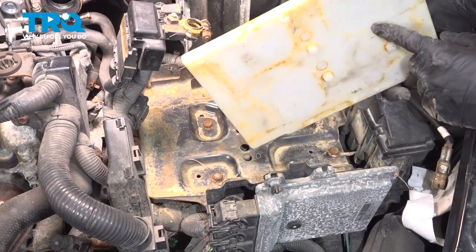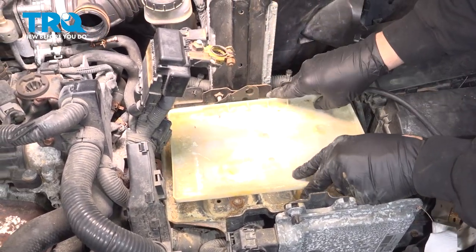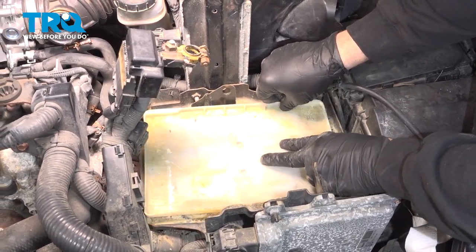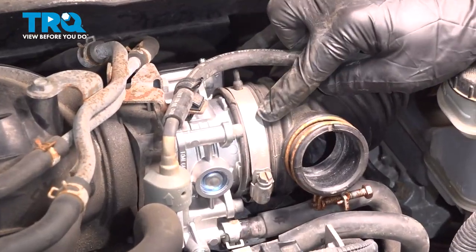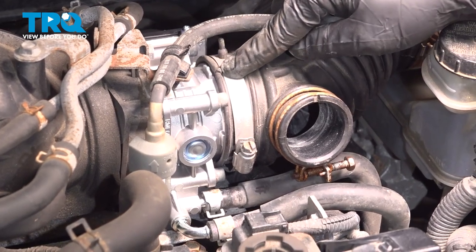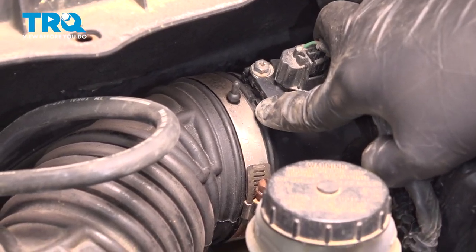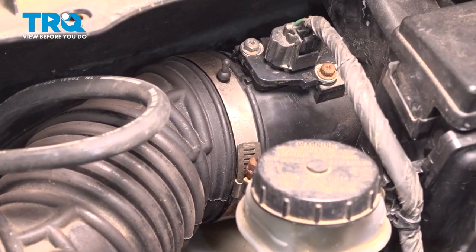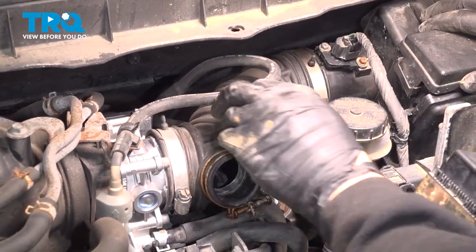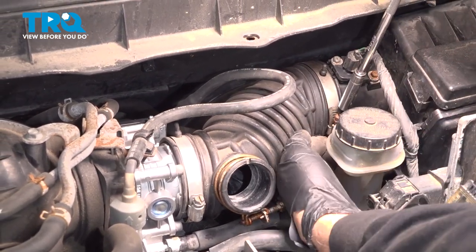You can sit in your battery tray. You have three pins here that need to line up. Before tightening up these clamps here, you want to make sure that the hose is lined up. There's a little arrow right here that needs to line up with this tab, as well as over here there's a little notch with a little nub on the airbox itself. Simply grab that tube and twist it accordingly, make sure that lines up, and then tighten those clamps down.